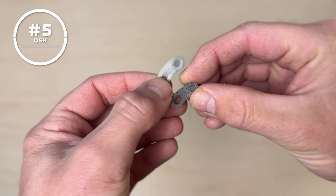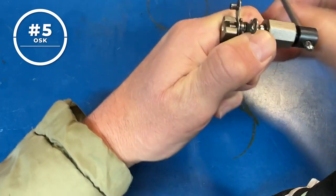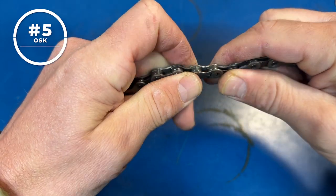The quick link will come in real handy one day when your chain decides to break on that one-in-a-thousand factory defect. Instead of resetting a compromise pin with your mini chain tool — I carry a Crank Brothers M17 — you can remove the broken link and replace it with your extra quick link. Apply some pressure to the pedals while holding the brake and it should snap right into place, and you're back on your way.